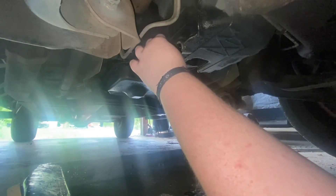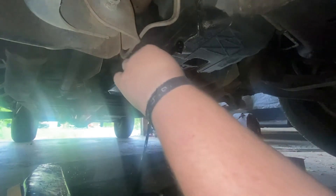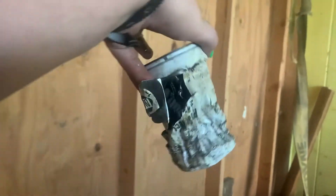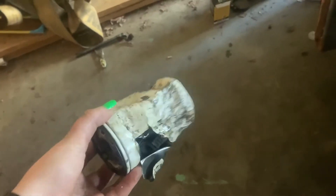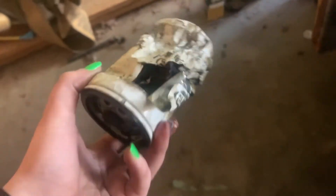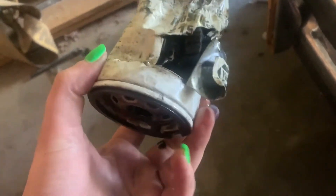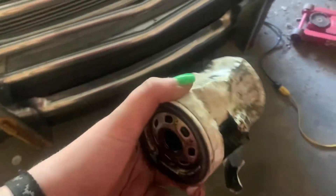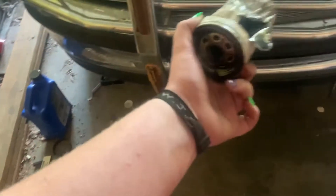Yeah, you can tell it was due for a change — and there you have it, your hands aren't dirty. So I'm going to set my drain plug down. This is what happens when you over-tighten your filter — I over-tightened this filter last time I did an oil change and this was the aftermath. It broke the filter. We were running a Pro Select; we're going to run an AC Delco Gold. We had to pretty much destroy the filter and finally resorted to heating it up to get it off. We're going to fill this filter up a little bit with some oil, run some Lucas in it, and that should be it for the oil change. Don't over-tighten your filters, kids.